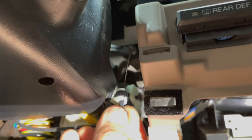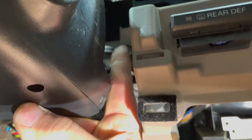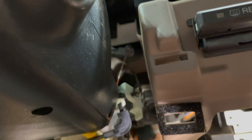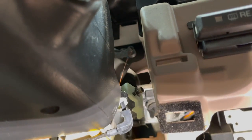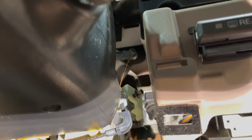You can see this cable goes up to that connection. We're going to pop this cable off the shifter arm — usually you can just lift it up with your finger and it'll pop right off. This one's giving me some trouble, so I'm going to go in and pop that cable end — there's a little hoop off that pin — and that's directly connected to your shifter arm.